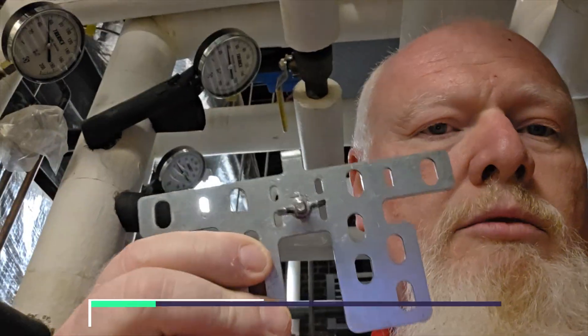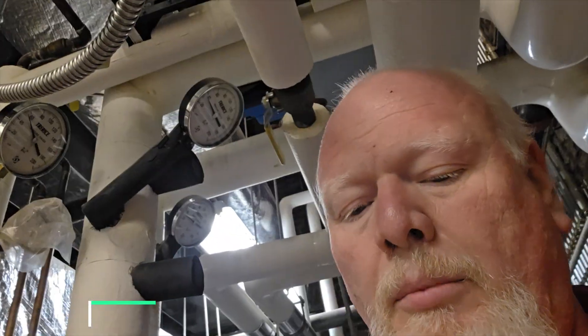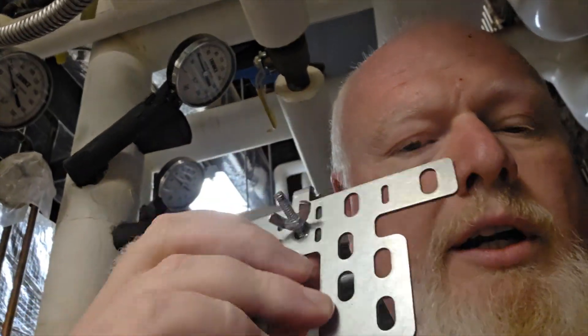The problem is that type of mount will not work out of the box with this type of actuator. So I've had to do a little bit of ingenuity. Basically, the bracket that comes with this new actuator is pretty simple and straightforward — I just punched an extra hole there to run a couple of bolts through it so I can bolt it to that housing.